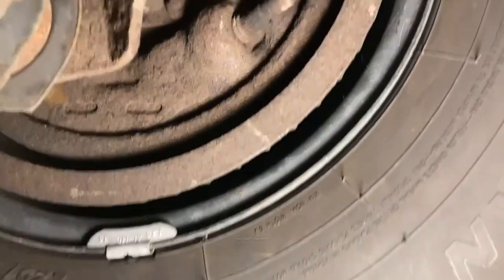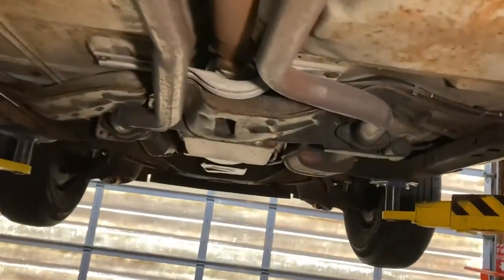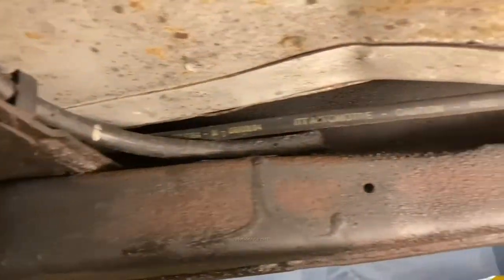So just checking everything else, you know, to see any leaks around the axles or brake drums. Wheel cylinders are probably okay without pulling a wheel, I don't know for sure. But this is just a quickie inspection. I'm not doing a full inspection here. Just want to get a feel for, is there any safety concern when I change the oil? Every time I have the car up in the air and change the oil, I also like to look for safety concerns, that's all.